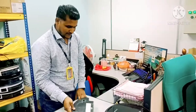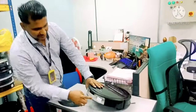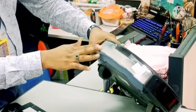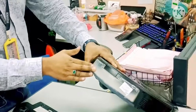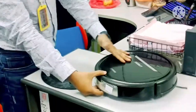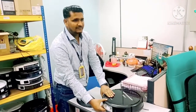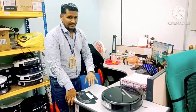Here I'll show you a real example. This customer was using detergent — inside you can see it's totally white, and I cannot see the pipes or anything inside. They were using detergent inside the water tank, that's why this is happening. This unit also has the same problem — the customer sent it in because the robot could no longer dispense water. This is the main reason why the water cannot dispense.